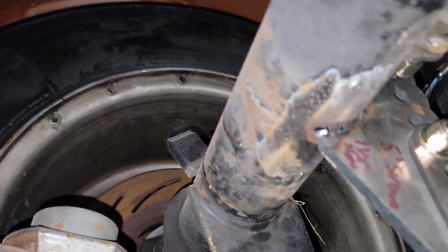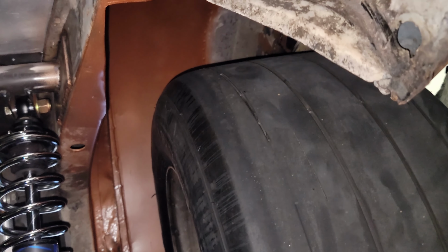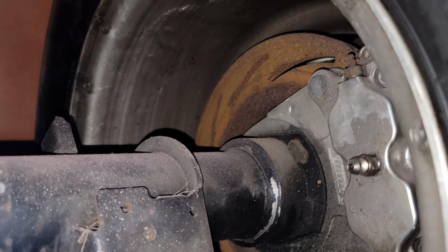All right, let's make our way. So, I got plenty of room. This mini tub gives me plenty of room to put whatever type. Matter of fact, yeah, this guy would work, even the tire size would work if I had more offset, and that's my issue. I need a higher number offset to bring it back, and you know, it'll clear the brakes, so that's good. The fact that the brakes will clear is not a problem.